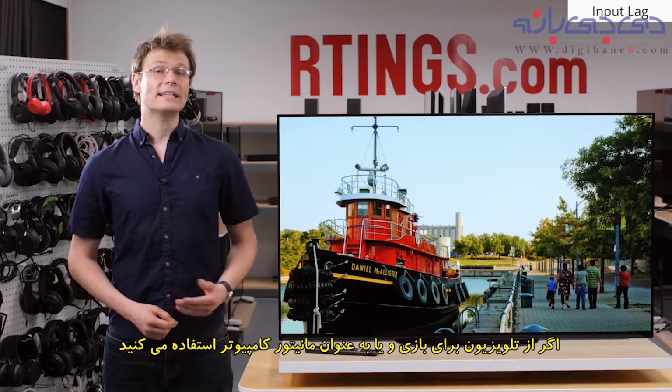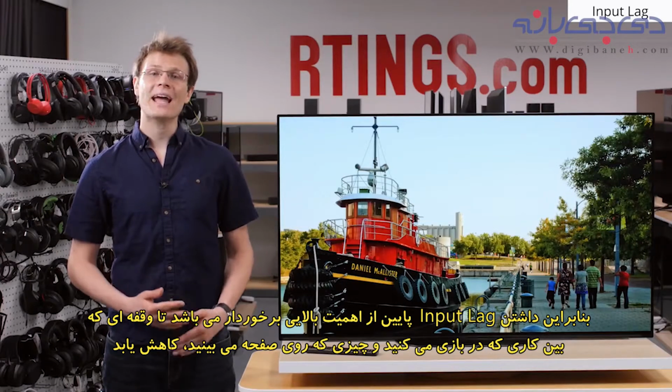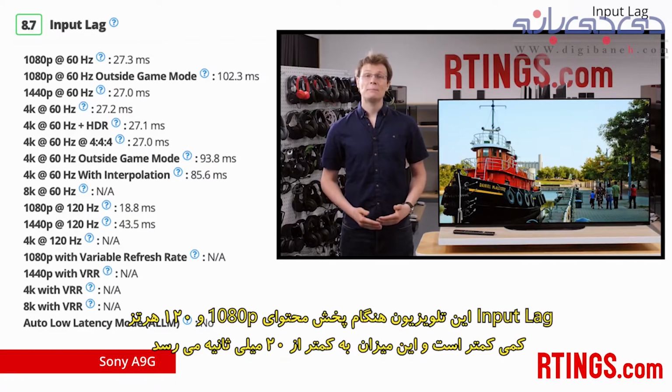Now, if you plan to game or use the TV as a PC monitor, then a low input lag is important to reduce the delay between an action in-game and when you see it on the screen. The input lag is low at about 27 milliseconds for 60 Hz content, whether HDR or SDR. At 1080p 120 Hz, it is a bit lower at a bit less than 20 milliseconds.